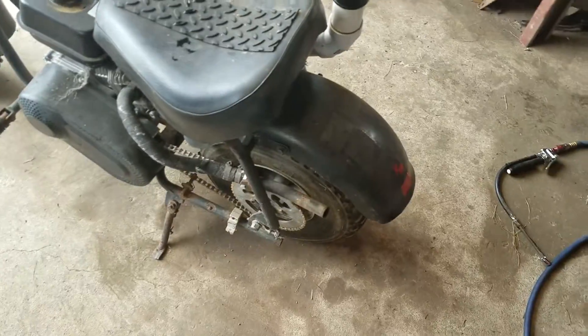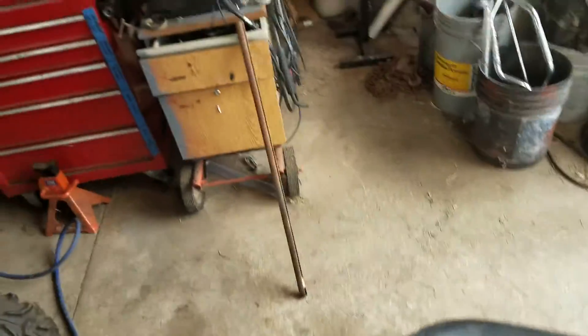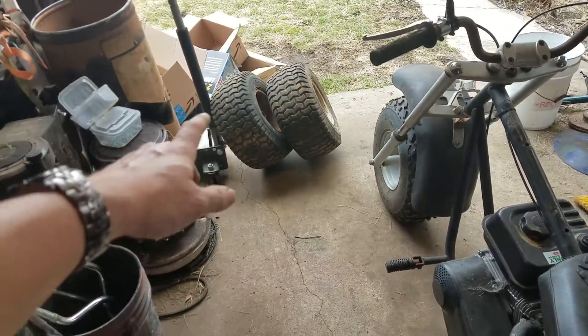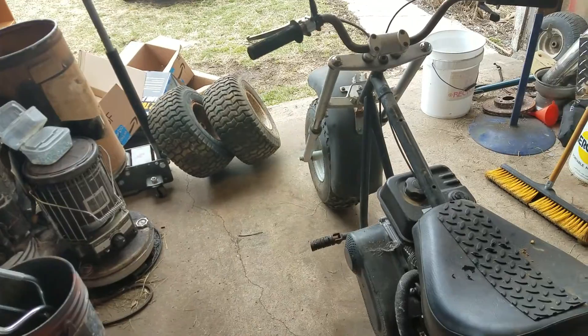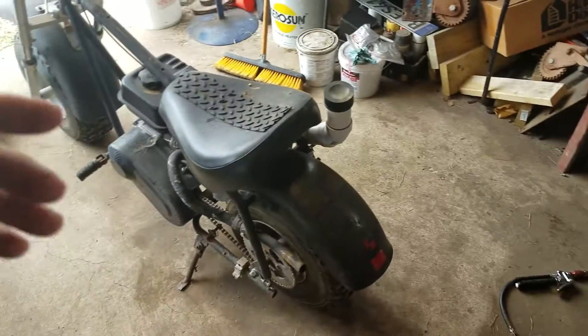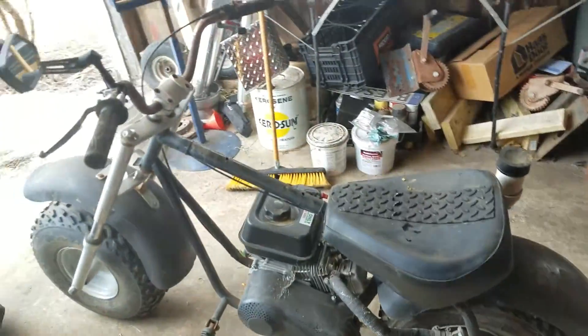While I put it in here, I'll be slightly extending the frame to mount some pillow blocks on. I'll be running a piece of shaft through there and using the tires off the Gravely — originally when it still had the transaxle — they're pretty much the same size, a little bit wider than these, so I'll be putting those on here. I have a new sprocket for the back, still the same 40 chain, and I have another torque converter for it.